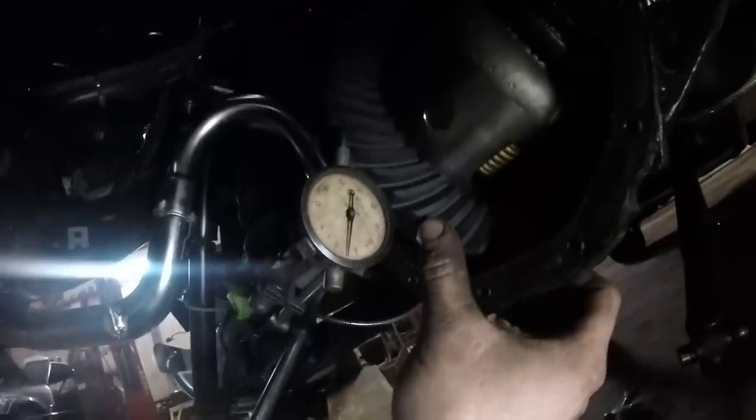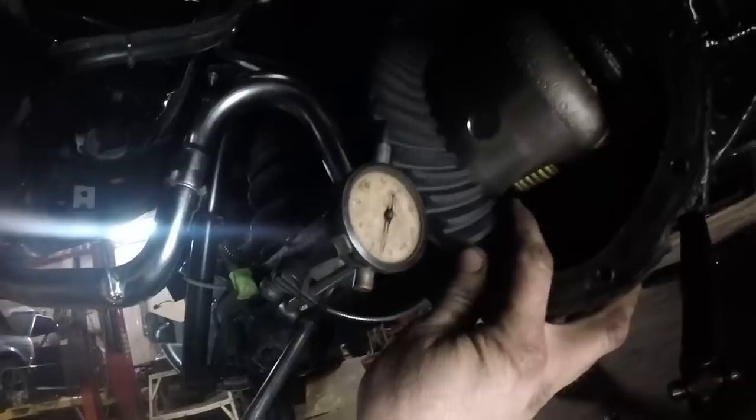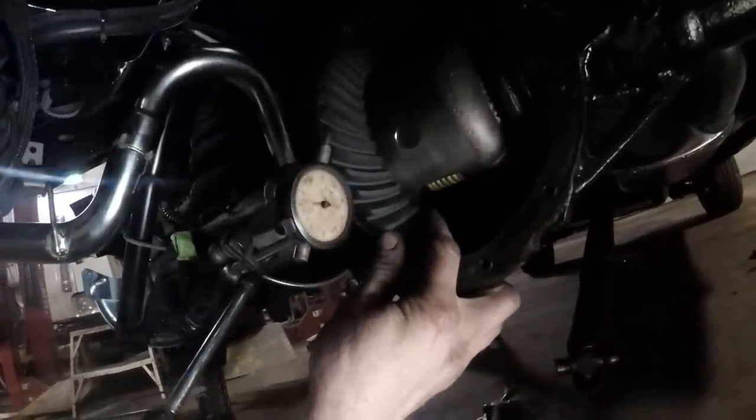You want to get the needle as close to 90 degrees on the tooth as you can and check it in three spots - then we'll call that good. And I swear that was the first time I shimmed it up and it actually worked pretty good. So if I could get as lucky with the pinion as I did with the ring, then away we go.